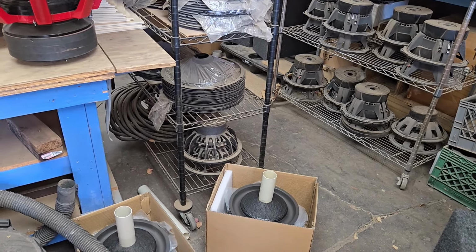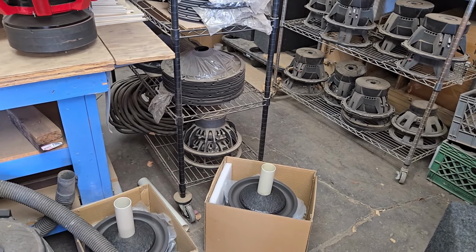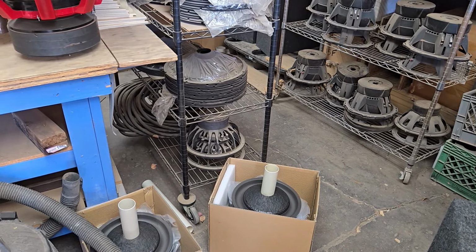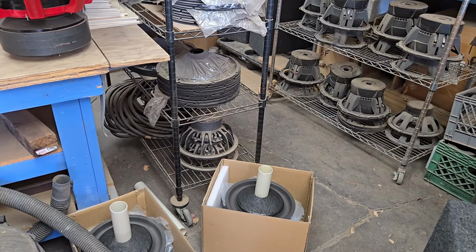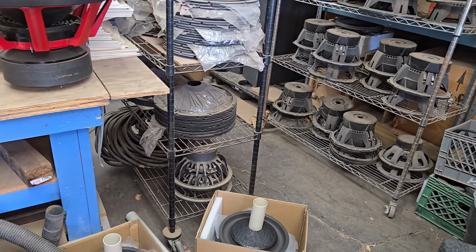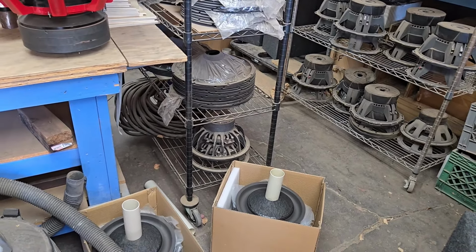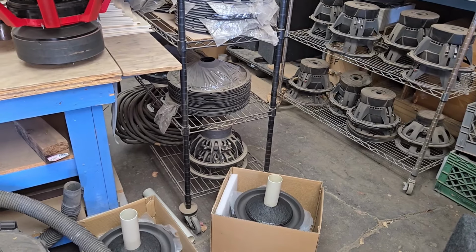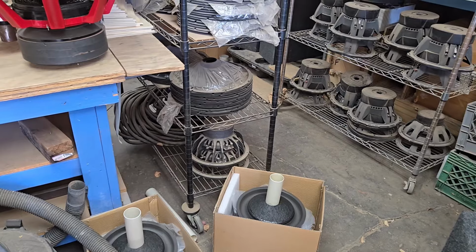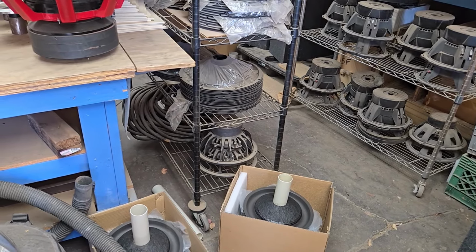and then I will also include some business cards, because the pole should be the same. I don't know why they would modify the pole. They typically modify the top plate when you want to accommodate a larger gap, just because your manufacturing over in China has already tooled up for that pole size, for that coil and that shim and all that kind of stuff. And MTX ran into this problem too. MTX on the 9500, the older versions have a tighter gap. They're not better. That's why they changed it to a larger gap.